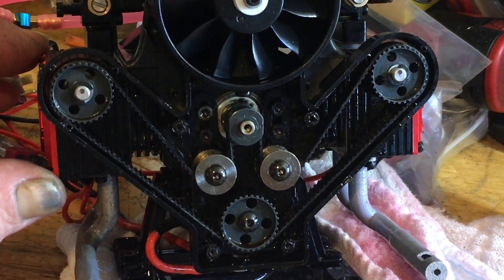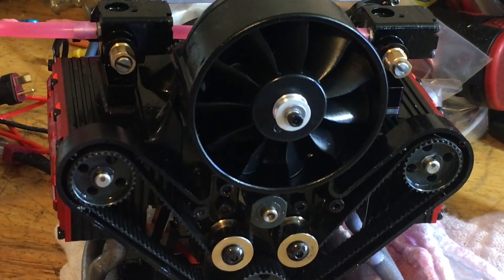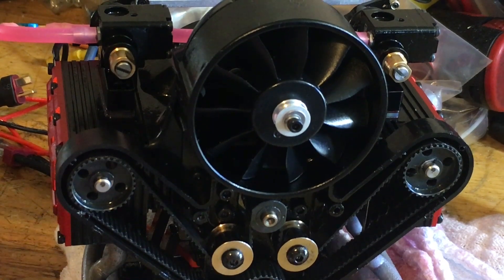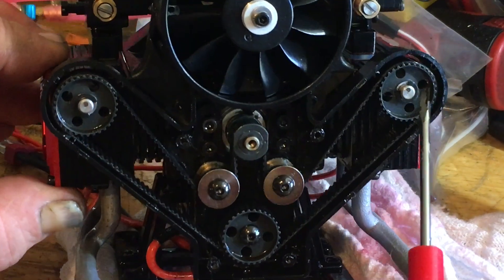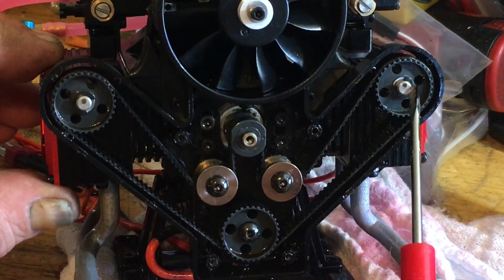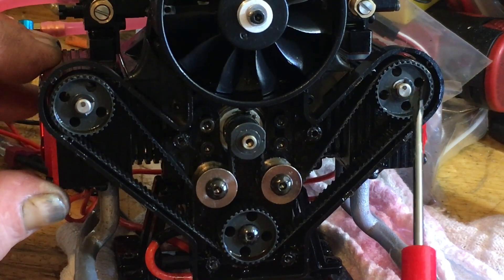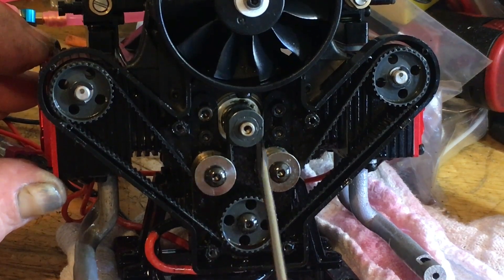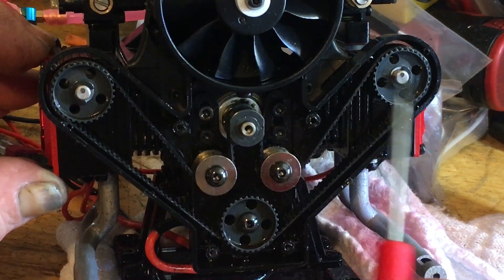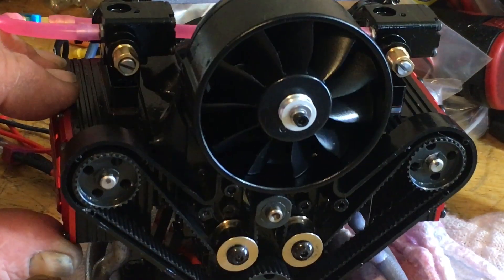When I couldn't get mine started I couldn't figure out why - between the carbs being out of whack and the timing belt. This cam was way over here, the little mark was way off. I just undid the nut on the pulley at the crankshaft, turned this back, and it started right up.